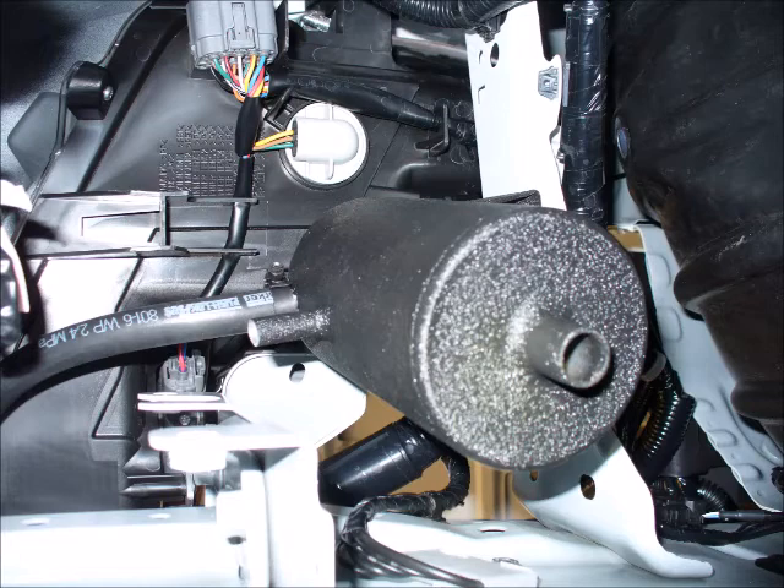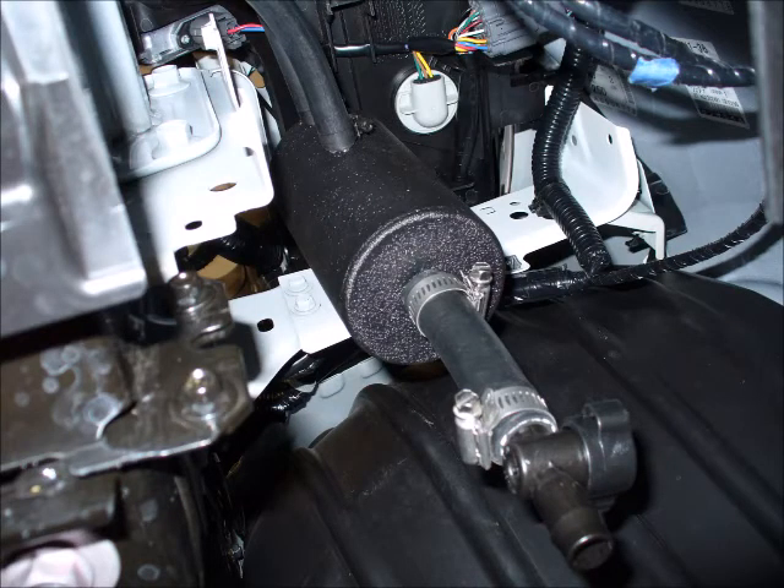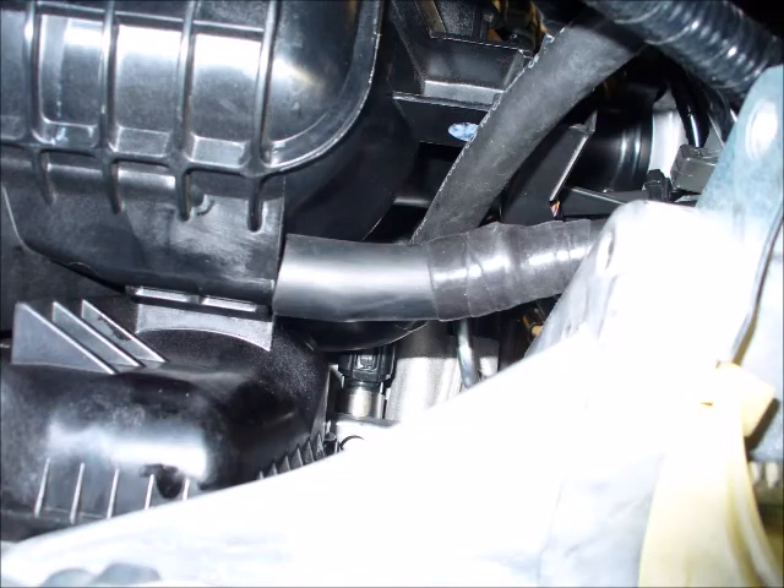This lower tube is the bottom of the intake manifold. This is a shot looking upwards behind the driver's side fog light up to where the catch can is installed inside the fender. You can see the upper hose is connected — though I messed up, as that's actually the hose that should be connected to the lower barb, which I had to go back and reverse. I haven't installed the drain yet, but there's a lot of room here for the catch can.